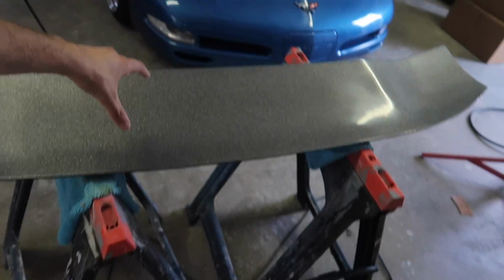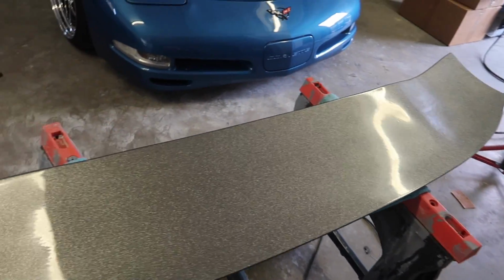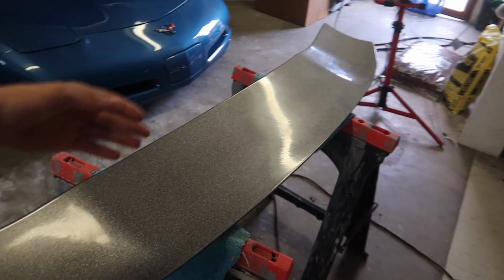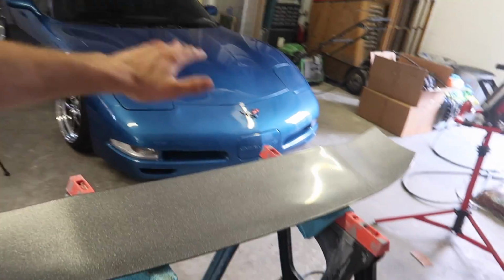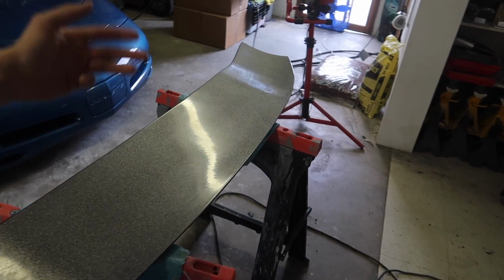Once again, on this thing, we did a super metallic graphite on the base coat, and then from there, we did 2 coats of clear with flake, and then 2 coats of just normal clear, no flake, and then we did a second session with 4 coats of clear with flake, and then another 2 to top that off.